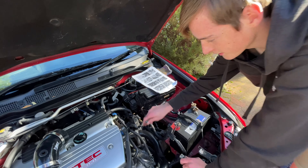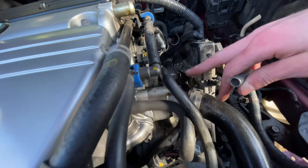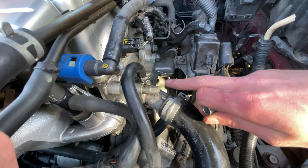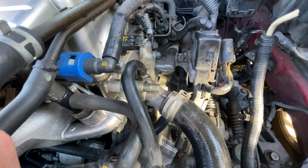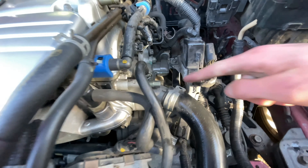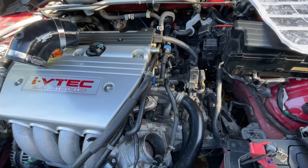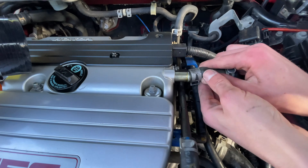As you can see, we've looped the coolant line back on itself. It does spill out a bit of coolant so have a rag handy — it was a bit old and crusty to get off, but once we got it off it was all good. Just jam that one straight back on, use the stock hose clamps again, and now we're going to link the breather up.